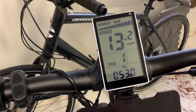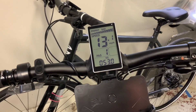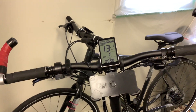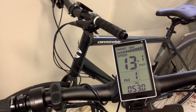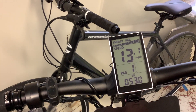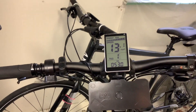But it was fully charged. I will not be able to ride it for the next maybe four or five days, and it's not good to leave the battery fully charged. So I'm running it down, and when I'm ready to ride it again, I will charge it up. Because of the chemicals involved in this process, it's better to do that than to leave it fully charged during these four or five days. The battery will last longer.